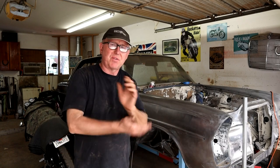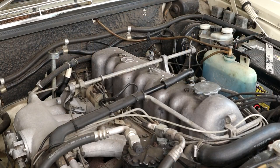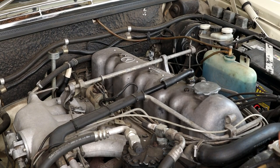Hey guys, welcome back to the channel. It's nearly 100 degrees today so I'm not going to do any welding because that's miserable in the heat. I thought I'd take the chance to adjust the valves on the six-cylinder Mercedes, the M130. I'm a little overdue on that - it should be done every 12,000 miles and I'm probably about 15-16,000 miles. I've got the cam cover gasket to replace so let's pull it in and take a look.